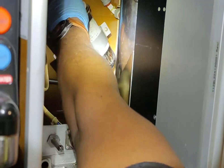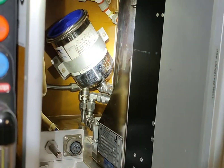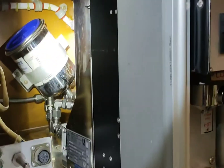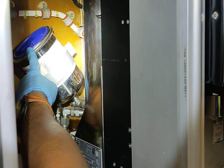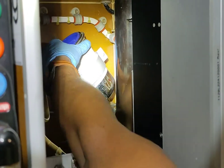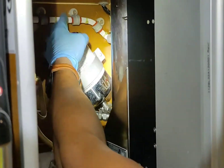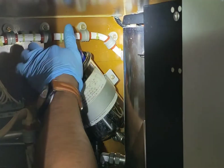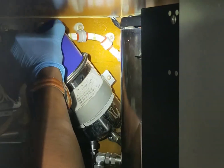You can see there's a seal — this seal ensures there will be no leakage of water. The seal looks like this. Now you can see the filter. To remove the filter, you have to turn it anti-clockwise like this, then release it from the housing and remove it.